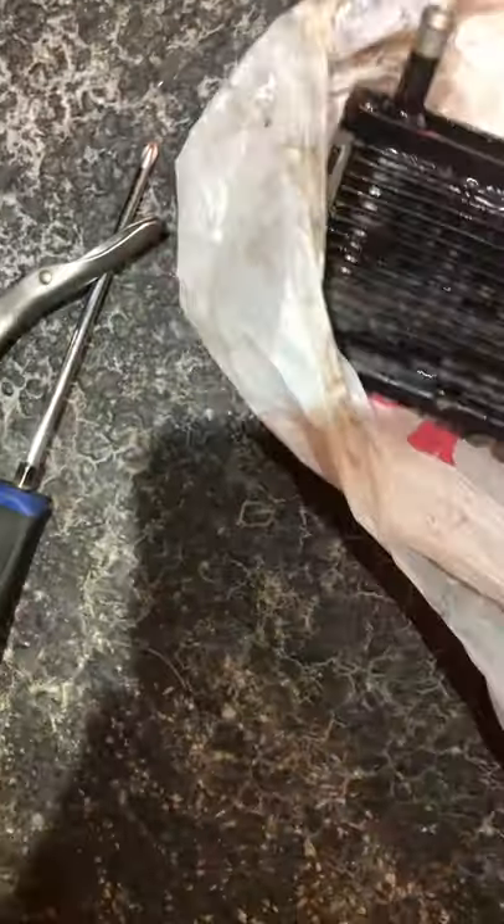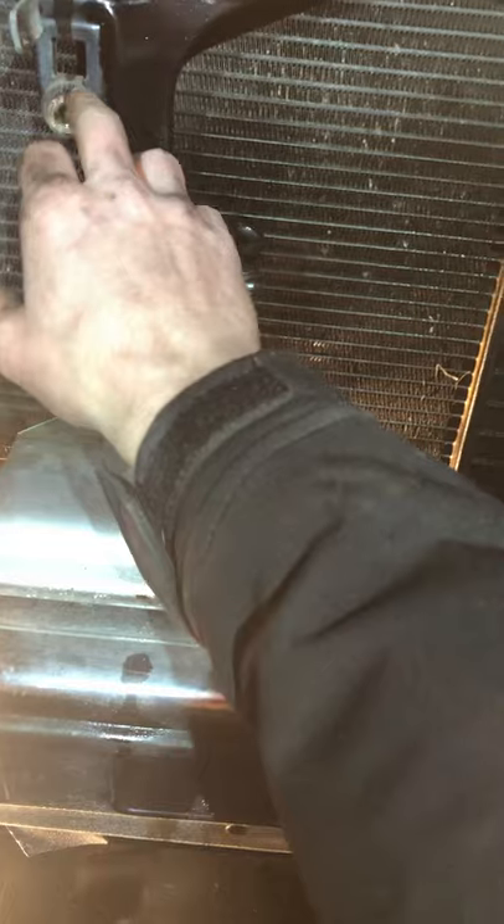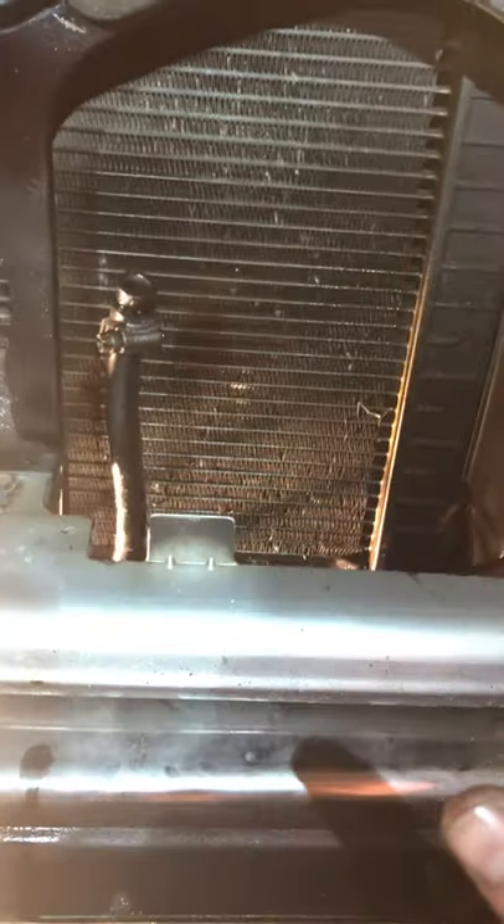I already have the cooler out, but I'll show you it. This is the old cooler — looks pretty messy because it's leaking pretty good. You'll see it's tucked right here facing the truck, bolted up right here and right here. There are two — I believe they're 10 millimeter bolts. You pull them out and the cooler will come out. Then it's just a matter of undoing these hose clamps for the trans-cooler lines, and once you get that, you can install your new trans-cooler.